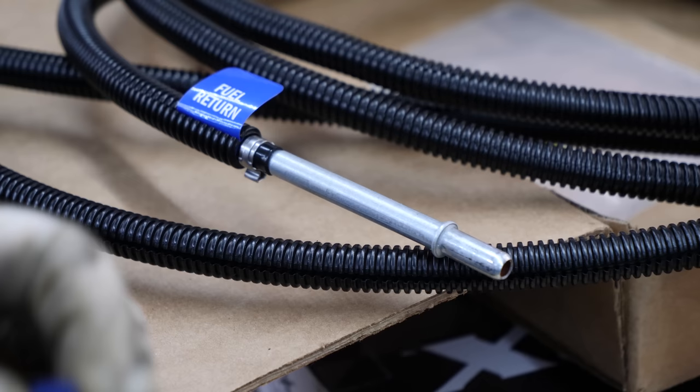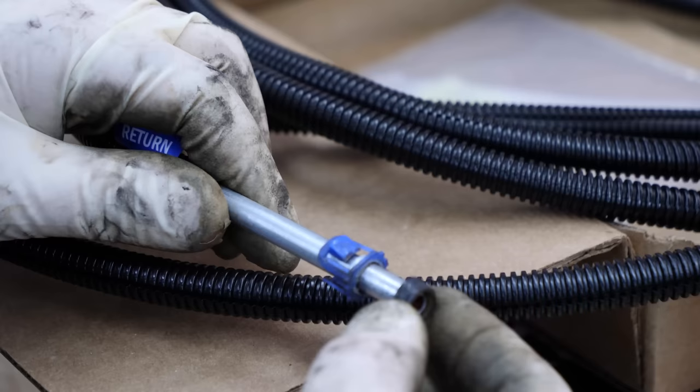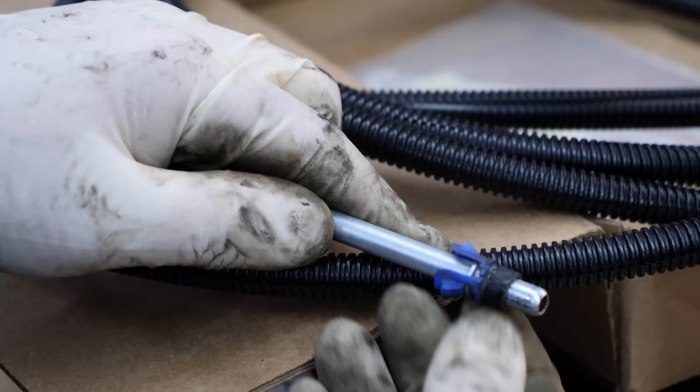Here's our new return line. You can see what I'm getting at — this clip would sit on there like that, and the little bushing goes on like that, and that should clip in. Hopefully this all lines up fine. Normally, if everything came out how it was supposed to, when I slipped the little tool in, the tangs would have spread, this whole thing would have came off, and the clip would have stayed inside the fitting. So essentially when we install the new ones, all we're doing is click — and that's the end of it.